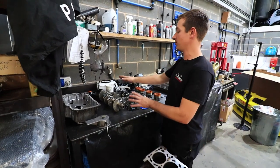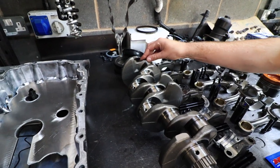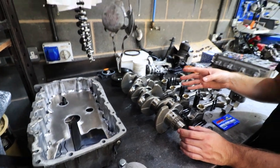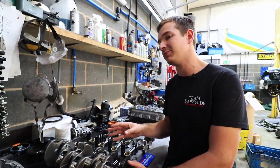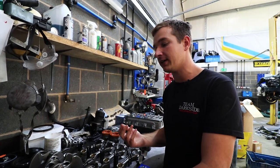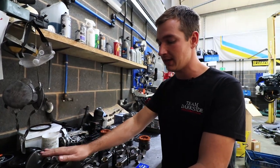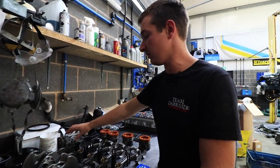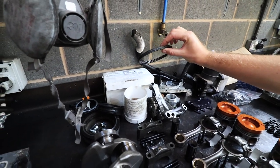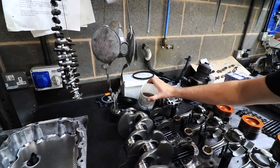This engine is running the standard crank for this oval port engine — it's in absolutely perfect condition. We generally run the PD crank, but this is running a bit less power for circuit use so you're not launching with a lot of torque like in the drag cars. We thought four kilograms lighter was worth doing. That means we use the oval port oil pump and belt — that's all new. The piston rings are just hiding in that buffer oil in there.